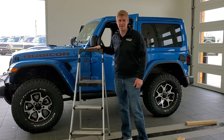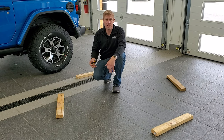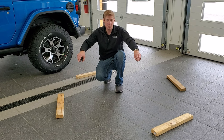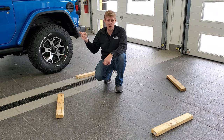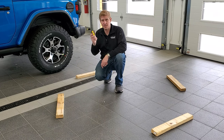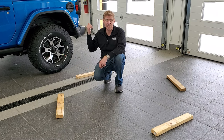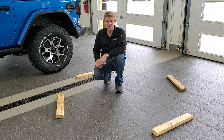You may also want to grab a ladder. Next, find a spot to put your hard top before you take it off. I suggest a place out of the way, maybe a corner of a garage. You're going to need five feet wide by four feet long — these two-door hard tops are actually longer than four-door hard tops when on the ground. Measure that out and put your two-by-fours down so you don't scratch your hard top, especially since this one is painted.